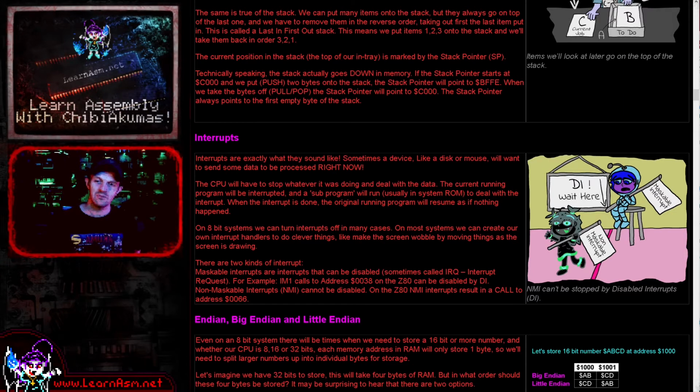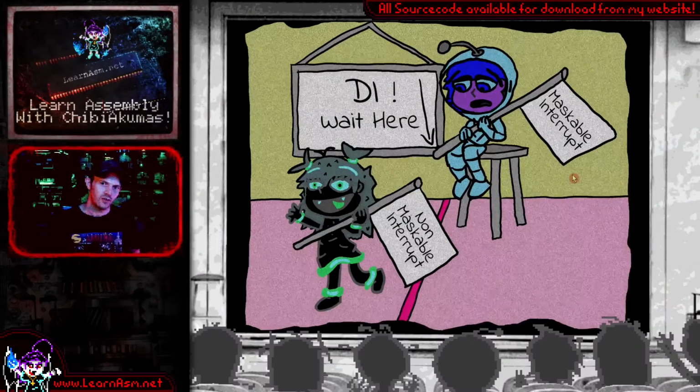And so what happens is something known as an interrupt, which is literally what it sounds like. It's someone shouting at you, hey, stop what you're working on there. You've got to work on this VBlank right now because it's about to finish. This is what the interrupt is. But there are actually two kinds of interrupts, and they have rather odd names. We have what's known as maskable interrupts and non-maskable interrupts, and these are very different. So just quickly, we're going to discuss what they are.